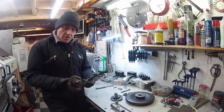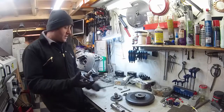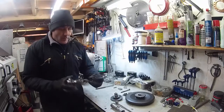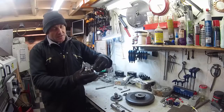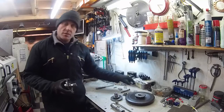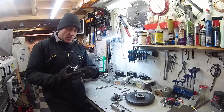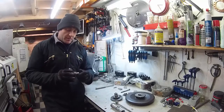The way we assemble this is that we'll put grease around this main bearing ring. The idea of the grease is that it will hold the rollers in place while we assemble it into our crankcase here in our fixture. The final assembly will have the spring on for the sealing gland, and the sealing gland sits over the top of that, so it's spring-loaded. What we're going to do first is assemble this entire bottom end of the engine up with no springs in and no shims - just the cranks, the glands, and the flywheel.